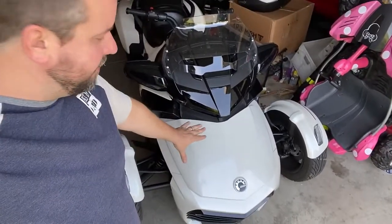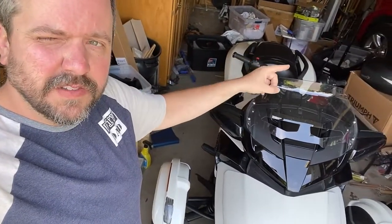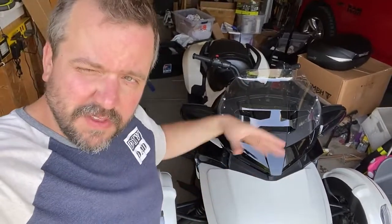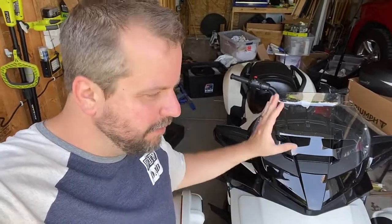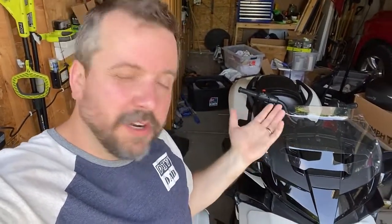There is a frunk in this one, so you do have a trunk here, and you've got two side bags on either side of the rear pillion seat. The problem is none of these will support a full-face helmet. The redesign — where they moved the radiator when they went from the STGS style to the F3 — shrinks the size of the frunk, so my full-face helmet won't fit there. That means I need to mount a top case to a bike that specifically was designed not to have one. This is the T, not the Limited, which would have had the big Can-Am dual helmet top case. So what we're going to do today is mount a luggage rack and a top case to this bike.